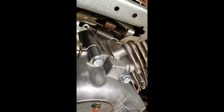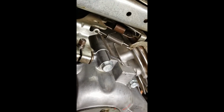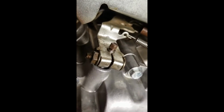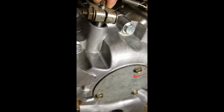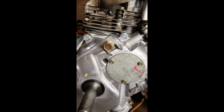And this just adds enough spring tension to keep it wide open and basically overcome the governed turn coming out of the governor. Again, if you got this wrong, your throttle control won't work, and the motor will grenade anyway, because the governor under here, if it's not held in place by this shaft, will come flying apart, and all those pieces will fly around the inside of the engine, and she go boom.